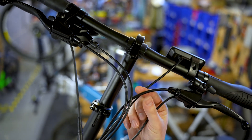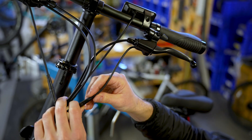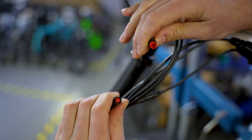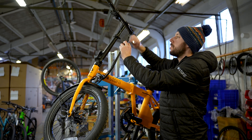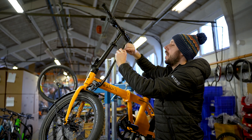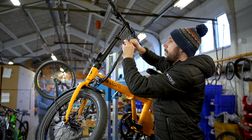The same thing applies to the brake sensor cables. On the handlebars, underneath the main brake cable, are the brake sensor cables — when you pull on the brake that tells the motor to cut out, so it's an important safety feature. The sensor cable comes down and meets here with two red connection points, similar to the display cable but with just two pins. Exactly the same thing applies: make sure the arrows are meeting up and the pins are nice and straight. You shouldn't really need to disconnect these, but if for whatever reason they do become disconnected, make sure arrows meet up and pins aren't bending.